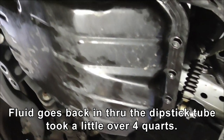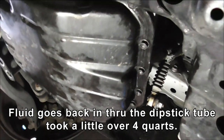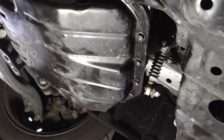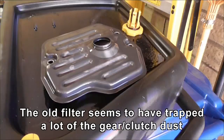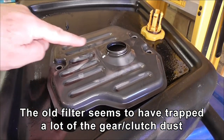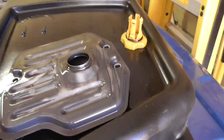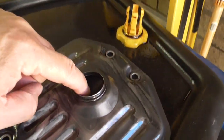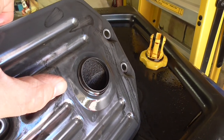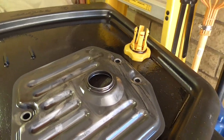Next thing is we're going to put the frame rail back on, screw all the plastic back together, and then we can think about putting some fluid in the gearbox, which we mustn't forget to do. I just wanted to show the filter — as you can see, there's a coating of that gear dust all over it, which is quite amazing. And the filter inside — it's pretty black — so it's obviously trapped a lot of this gear dust or clutch dust. I have no idea which it is.